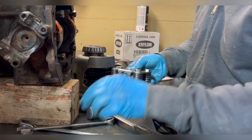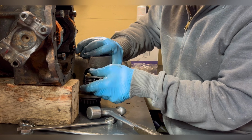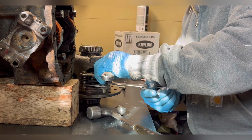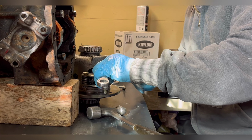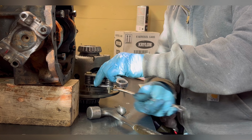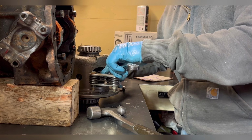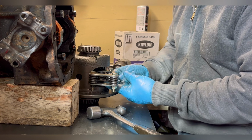But then you have to be able to hold it just on this edge, right about there. So right about there, I'll carefully take this bolt out. I may have to wiggle it a little bit, and it's right on that edge. Once you get a little tension against the carrier, it'll generally stay in place till you get that bolt out. In most cases, when I'm doing these, I'll be in this exact position 6-8 times before I get everything lined up to where it'll really go in.